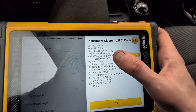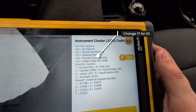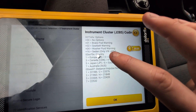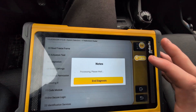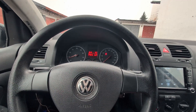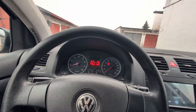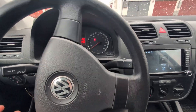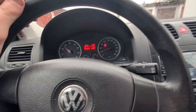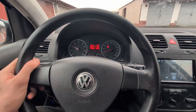Here is the seatbelt warning. I'm not sure if it is currently off or on, but let's try this. Right now we have to start with 00, so we can just change it to 2. We got rid of our seatbelt warning — I think. I still see the warning light, so let's check. No beeping. So that would be the first modification done.